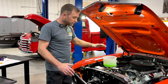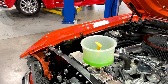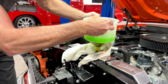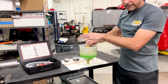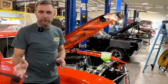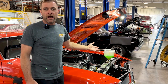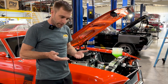Once that's done and we're satisfied, you can push the plug back into the funnel so coolant doesn't leak out, then use a rag to slowly pull it off while keeping the coolant. You can put the cap on so we don't spill. At that point you could cap it and go drive it, but a lot of times we're not in that much of a hurry. I would actually leave the radiator cap off overnight, let the cooling system condense, and you'll notice the level drop a little. In the morning, come in and top it off to the top of the radiator and cap it.